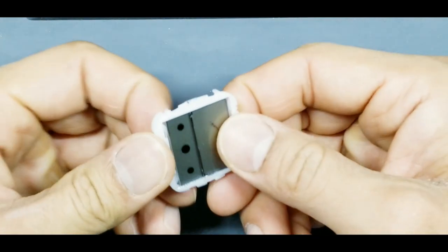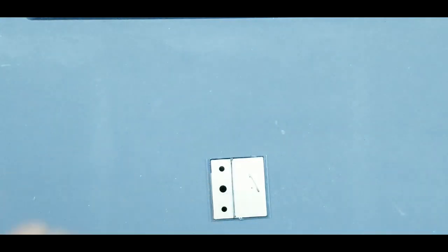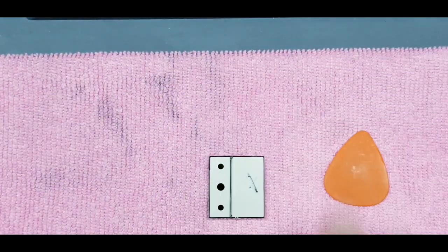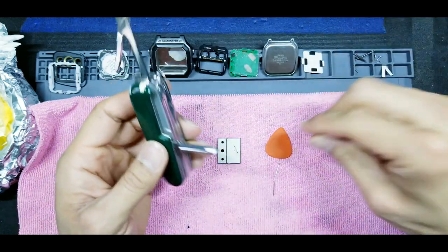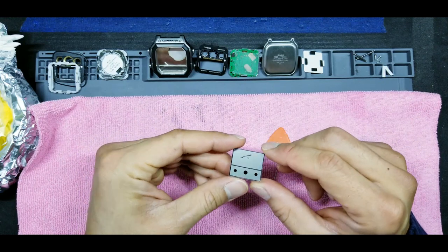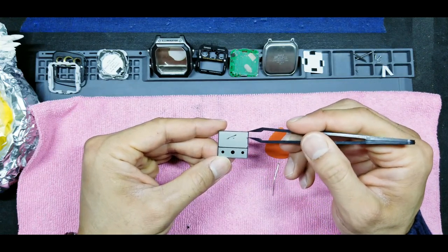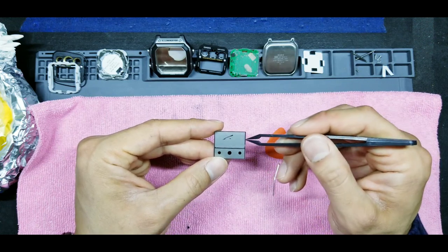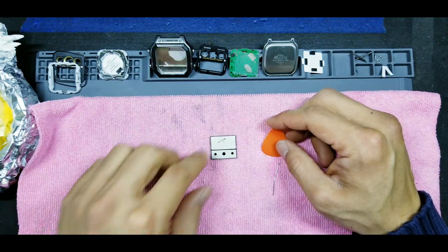Take the display off the white frame and set that aside. You'll also need a towel — I like a microfiber towel — and a small pin and ideally a guitar pick. We've made our score line; now we need to separate the top bun from the patty, but leave the two layers below untouched. That top layer is glued to the one beneath it, and you can't just pry it off — it's much easier using a chemical. That's where Goo Gone comes in.